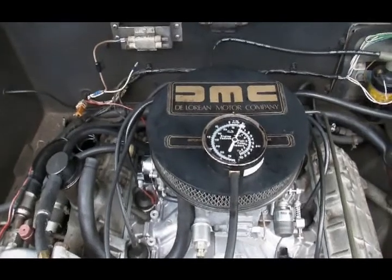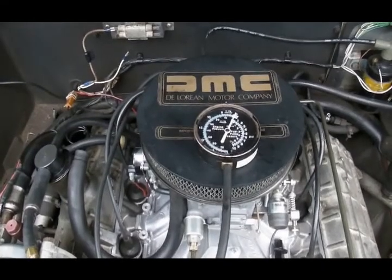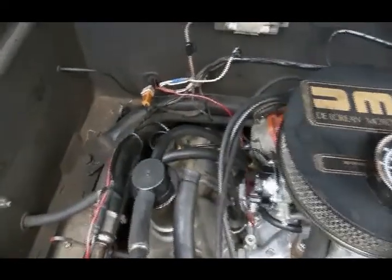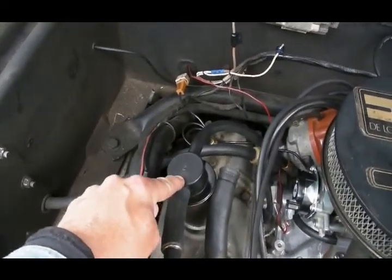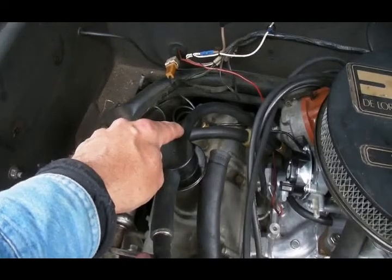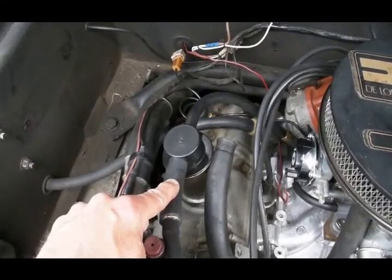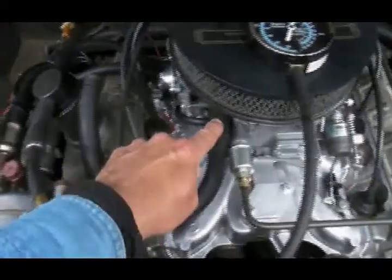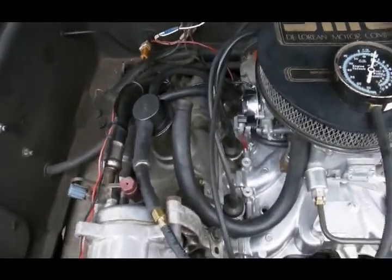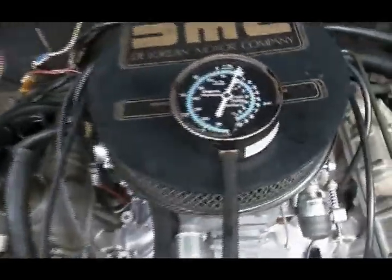On my car, I run about 2 to 3 inches maximum vacuum on my crankcase. I would suspect that his numbers should be similar. Now, us carb guys, we turn the oil filler cap around and use the 5/16 barb for PCV and the 5/8 barb for the fresh air breather from the air filter. This is my usual fresh air hose. I have it disconnected so I can attach the gauge. On his car, the cap would be turned around this way, but